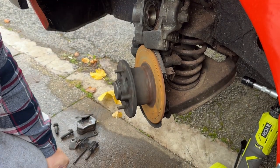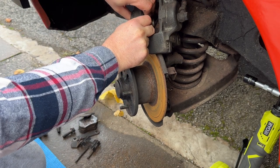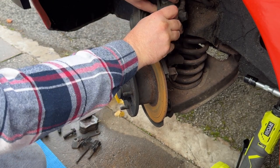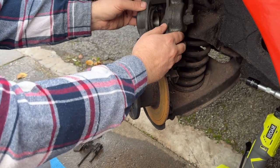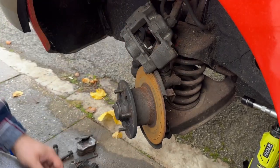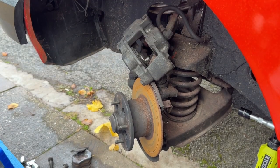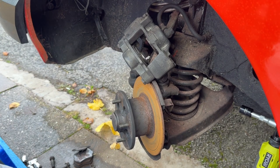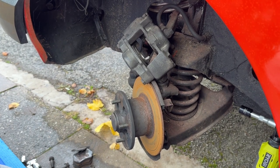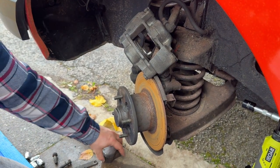Very minimal play in that. Yeah, you don't see that in many classic cars, but all you've got to do is push them back, which should be quite straightforward because they're very clean. I say the owner that had this before me did all of the brake lines and calipers to put it back on the road after it had been sat for 17 years. So it's pretty tidy. But that's how you take the pads out anyway.